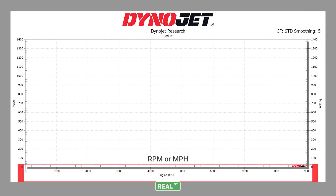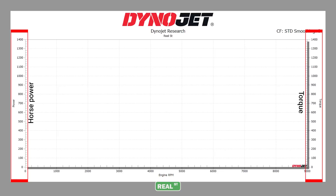For the sake of learning, we've compiled some dyno sheets from our inertia Dynojet and we're going to go through them and discuss the good, the bad, and the ugly. The horizontal axis is engine speed or vehicle speed — think of it as time, with the left side being the beginning of the run and the right side being when the vehicle reaches maximum engine or vehicle speed. The vertical axis is horsepower or torque; the higher the line goes, the more power is indicated. Sometimes you'll see a split vertical axis with horsepower scaling on one side and torque on the other, which can make comparisons confusing, so take note of it.